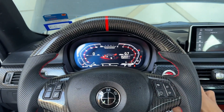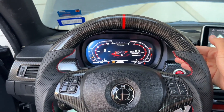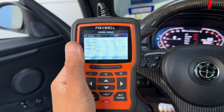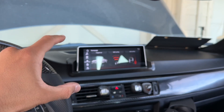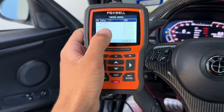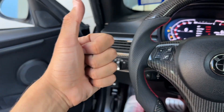After a couple minutes, turn the car off, take the key out, put everything back, turn the electronics on, and go back to the OBD2 scanner to re-scan. Look at that — codes found: zero. All of our codes went away after that fix. It turns out the only thing wrong was that bad fuse under the engine bay, basically causing all the O2 sensors to not be able to heat up properly. In five minutes with five dollars, we cleared out five check engine codes — that's a pretty good ratio.